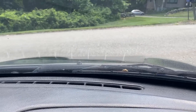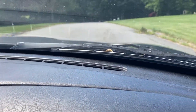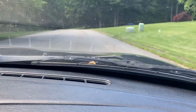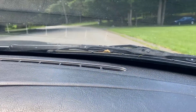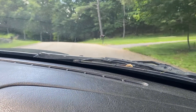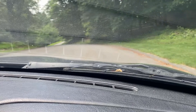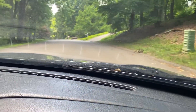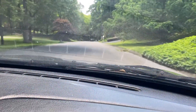On any test drive, go slow and listen. At the bottom you can go around a circle and kind of go full lock on the steering — you want to listen and see if you hear anything rubbing. Any noise is just stuff coming up off the road.